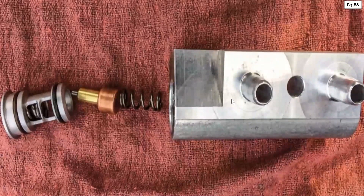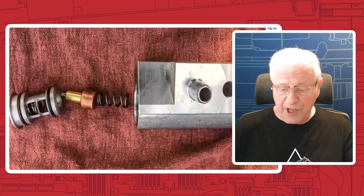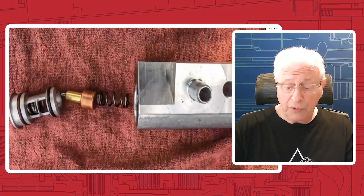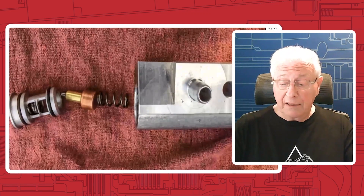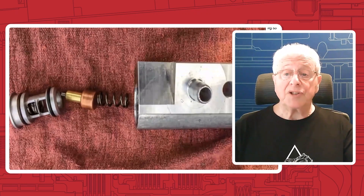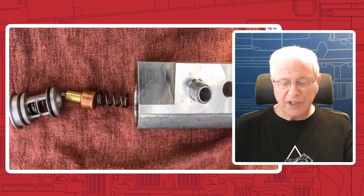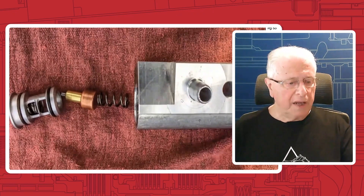At some point GM switched to a metal version — as you can see, it's a copper-bronze kind of thermal valve. Well, this valve has changed again. On page 52 we've given you the part number for the new thermal bypass valve. If all you're doing is changing this, you don't need a whole kit — you just need the o-ring to seal this manifold against the case. We've given you the part number for that o-ring so you can get only what you need.